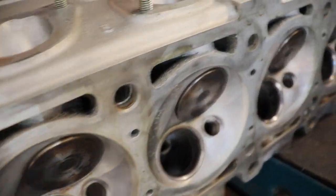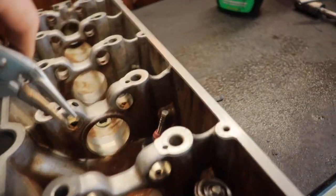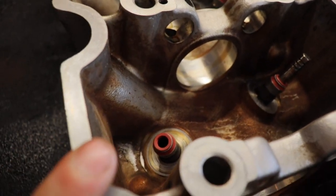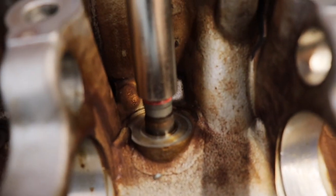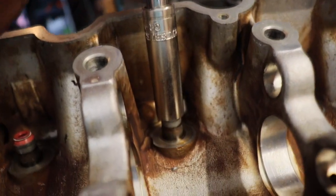Let me flip this thing over to show you guys how clean Ian got it. The easiest way to take the old ones out is you just get these thin needle nose vice grip type pliers and you squeeze them — not too hard, just enough where they bend a little bit — and then you wiggle them and they'll come right out. I'm not going to take the new ones out to show you because you pretty much ruin them. For installing them it's pretty simple. They make a special tool to do it but honestly all you need is an 11mm socket and extension. It fits perfectly over the stem, doesn't hurt the rubber at all. It goes right over the rubber and just barely sits on that metal lip piece at the bottom. With even pressure you just push them on, give it a little bit of a wiggle and they slide right on.